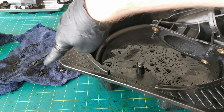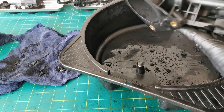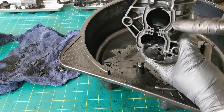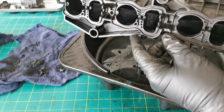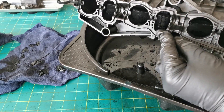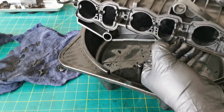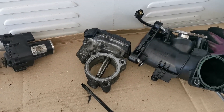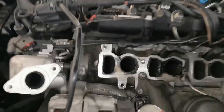You can see where I scraped some of it and wiped it on a rag — I've used about 10 different rags gathering it. Also make sure wherever the seal is that it's perfect; you want to have that all cleaned off. Where that seal sits, you need to have it immaculate. You do not want any sludge or dirt in there, which could cause an issue when you put it back on. Once I'm happy with all the cleaning on the manifold, including the attaching parts — the air inlet valve and that air intake pipe — I'm ready to focus on the engine side.